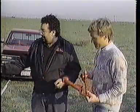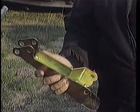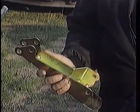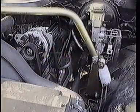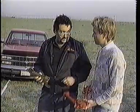Sturdy stuff here. Also, what we've done in this kit is gone in with the double shock mount, and what we have here is a frame bracket for the double shock. Connecting the double shock into the system of the frame, we've gone in with over-engine bracing. That will connect the right and left frame rails together for better stability.